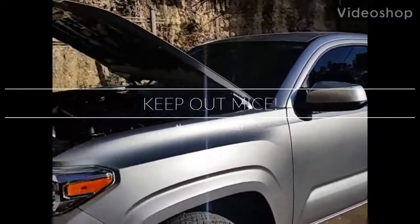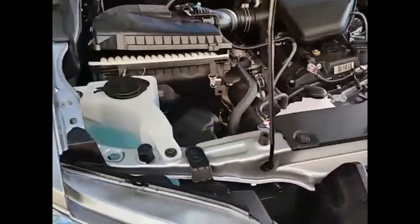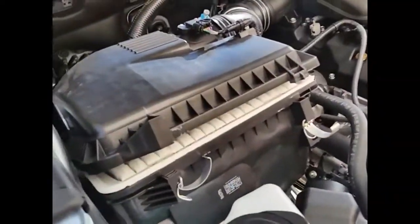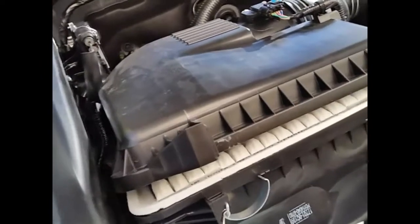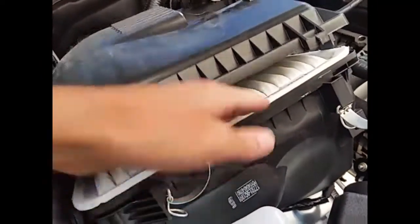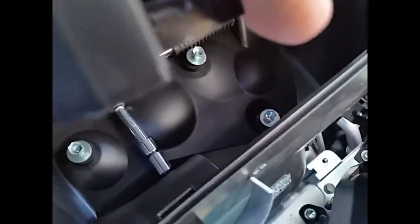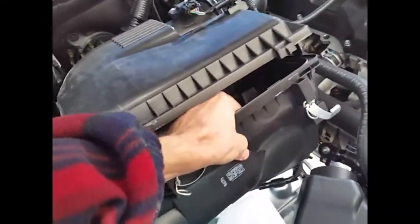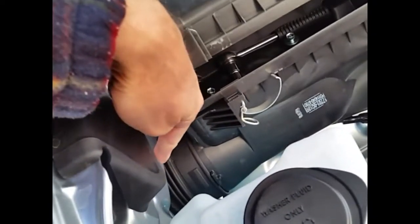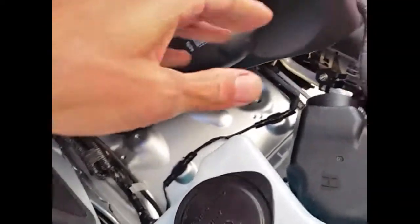This will be my first Toyota mod — 30 miles on the odometer on a 2022. Mice have always gotten into every Toyota I've had, so I pop this off, take the filter out, then use a 12-millimeter to take those three bolts off inside. This comes out — this is where I want to put a screen, because mice keep coming into all of our Toyotas. It's nice and clean to work on now.